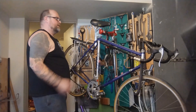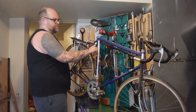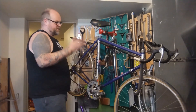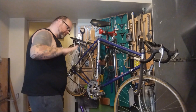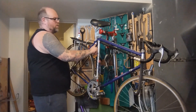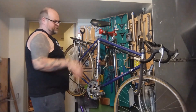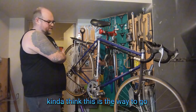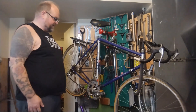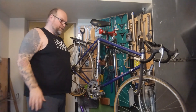If I was smart I would wire wheel all the bad paint and rust off and flick the rust out. You don't want to sand because sanding always pushes the rust deeper in with the tooth of the sandpaper - so you really want to wire wheel. I could nail polish it or hit it with some spray paint, but that's a project for a different day. If I do build this bike for me, it's going to replace the Nothing Special Schwinn, which is a shame - I love that bike.